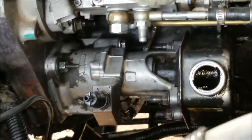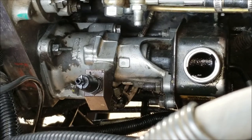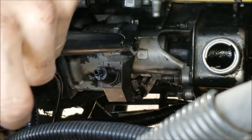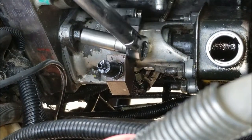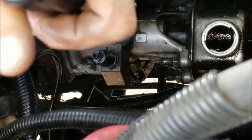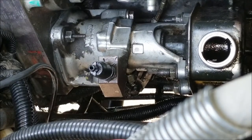I've got my torque wrench, which I need to adjust to a higher setting. You want this set to 57 foot pounds — we have 55 there, so bring it up to 57. Get your deep socket on there; you may have to lay over your engine bay and hold it on there with your hand, but you should be able to break it loose. Once you have the torque broke loose, take a regular ratchet wrench — not as long — and break that loose the rest of the way.